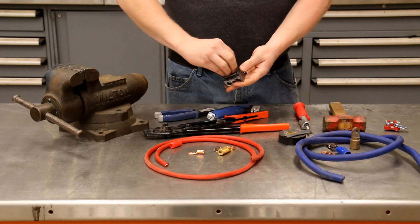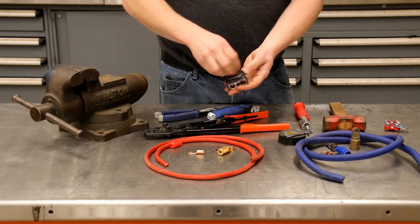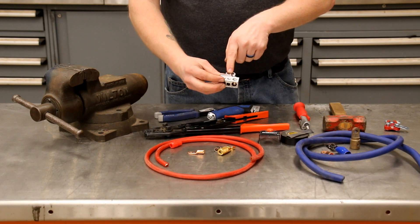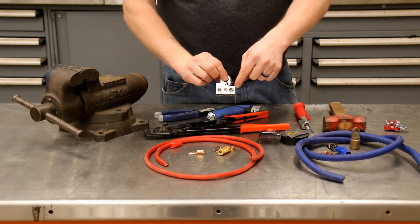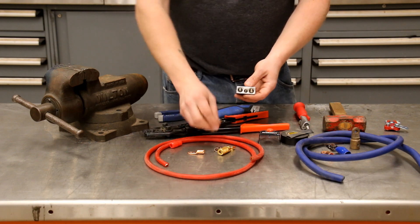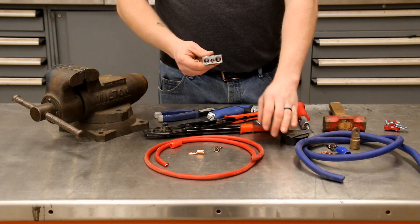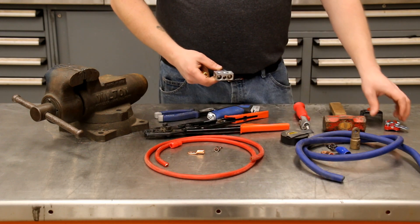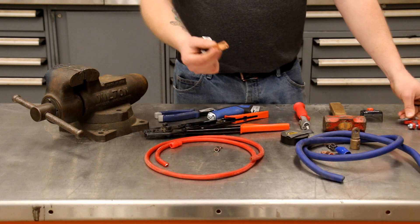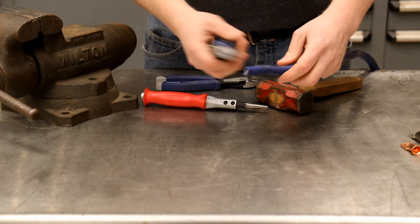There is another option: a high-end style battery terminal like this one from Kicker. It has an adjustable ring inside so it'll fit positive or negative, with multiple sizes of holes and set screws. These do work, but again you run into the same corrosion issue. These are mainly geared for car audio. I prefer to use a lead battery terminal with copper rings. This is copper clad aluminum in one ought size, which is common for car audio.